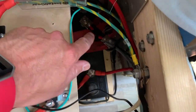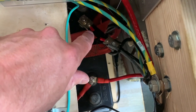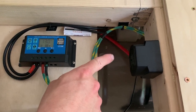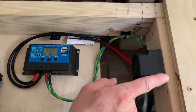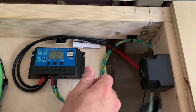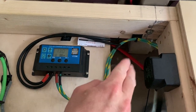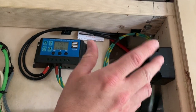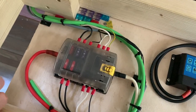Down there you can see my current shunt mounted to the negative terminal of the battery. There are two wires that come off the current shunt that go up to the amp meter. This combiner has the wire coming in from the front of the van and the wire going back to the house battery — so it's connected to both the starter battery and the house battery. Inside is a big relay. When you start the engine, the voltage goes high, this senses it and connects the two batteries together to charge them simultaneously. When you turn off the engine, the voltage sinks slightly, this senses it and disconnects so you don't run your van's starting battery down. It allows you to charge together and discharge separately.